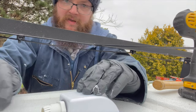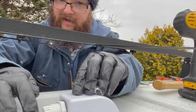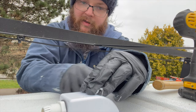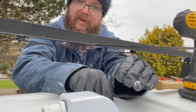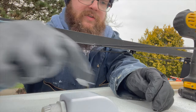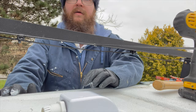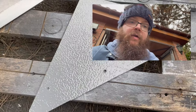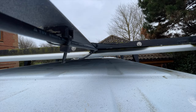You can see it's all squished out the sides — that's good, that's what you want. It might not look as tidy as some installs, but I know it won't leak and that's frankly all I care about. Let's spray up that bracket and get it mounted up here. Just giving it a coat of acid etch and then some matte black — you can't even see this on the roof, I don't know why I'm bothering. Thankfully this bracket hasn't cost me anything because this aluminium came with the bus originally and was used by the coach company to hold insulation on the side walls — reused and recycled.